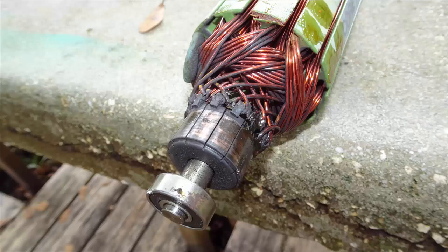A closer view of the brush assembly reveals a sticky substance on the upper brush. I suspect that substance is resin that dripped out of the armature while the motor was running — it's sprayed around the edges and is keeping the brush from maintaining contact with the armature. A close examination of the armature reveals the winding wires have been overheated, some turned dark in color, and there's a coating on the commutator and where the windings are soldered to it. That coating is the same sticky resin. On the outside edge of the rotor there's also sticky resin, where it dripped down after I shut the motor off. This rotor is definitely overheated.